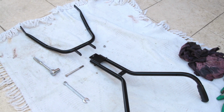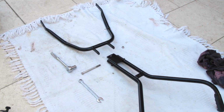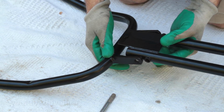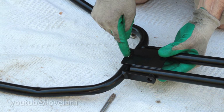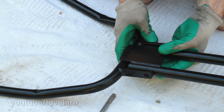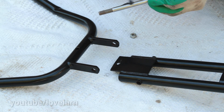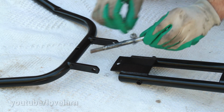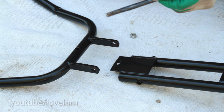I'll just grab the moly grease in this case, since we're working with the stainless, and start getting this back together now. The handlebars fit together like so, with a shorter bolt used to hold everything together in the extended position. The bars would otherwise pivot on the through bolt. The first thing we need to do before getting our cover plate in place is install the long connector bolt. It's a bit of a tight squeeze passing it through the bars, so a little bit of lube won't go astray here.